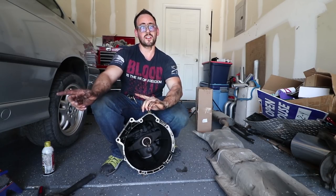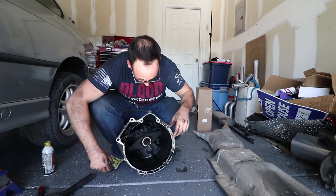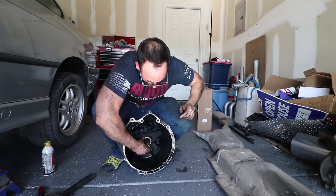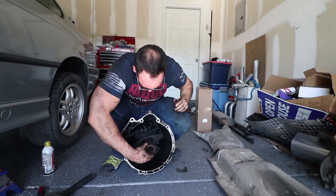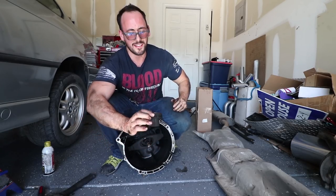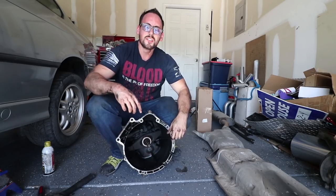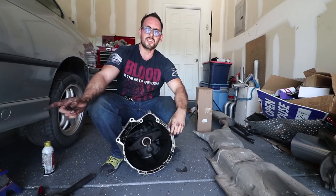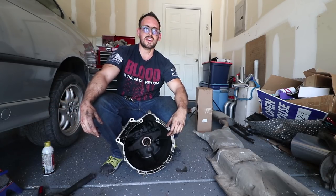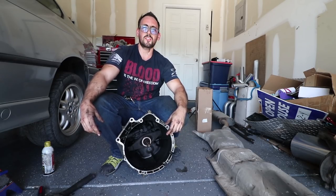We're gonna be switching to a single, so we'll have a different video for that. But yo, that is disgusting. Like, look, there's a lot of play in this thing too. That throwout bearing wasn't too bad, but it wasn't all that great either. But yeah. So next up, I'm gonna get the clutch and the flywheel off, so that way we don't have to mess with that, and I can get an idea of what the rear main looks like. And yeah, so let's get to it.